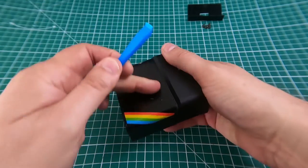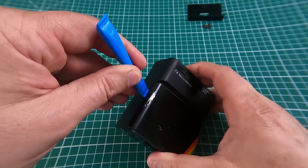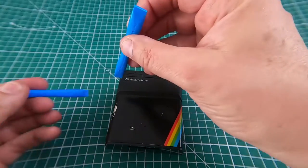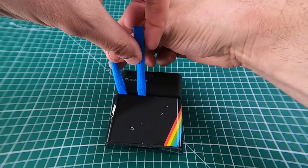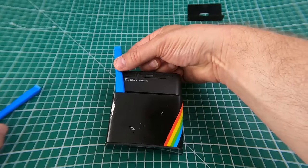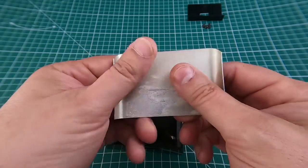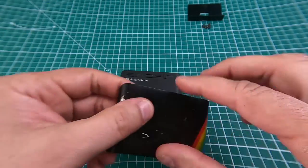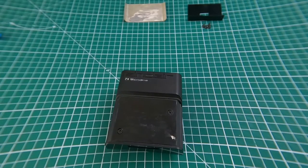This is going to tease off quite easily, though yours will take a bit longer. As I tease it off you can see it's lifting up, and what I can do is get another tool and get underneath and very slowly lift it up. You could hear a sort of tearing noise — that's because there's double-sided tape all over the back of it. This one has lost its tack a little bit but it's glued on pretty well, and because it's aluminium it'll bend, so very slowly tease it off. Do not use a knife because a knife will scratch, mark, and dent — use a proper pry tool.